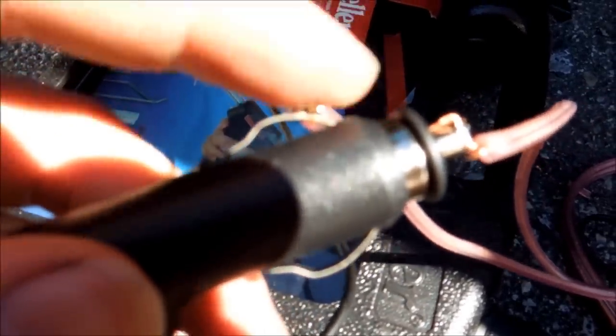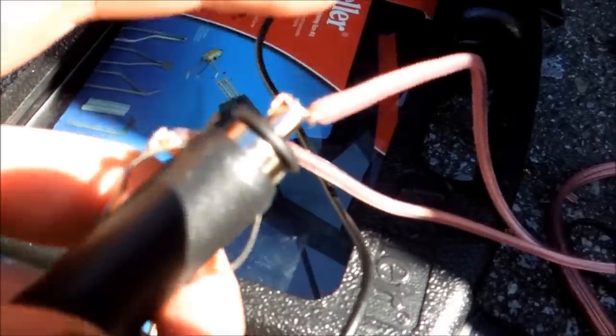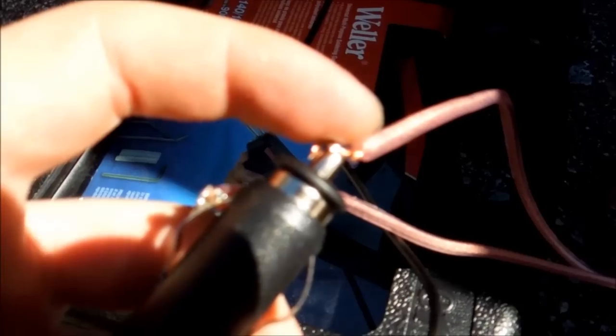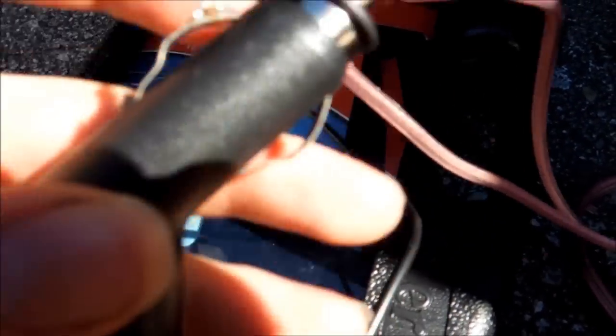You'll need to know this for the next part, but it's majorly just solder this onto the tip. The easiest way is to apply solder onto the tip of your gun, press it onto the tip so it absorbs, then lift it off. Tin your wire and then sink the wire in on the tip.